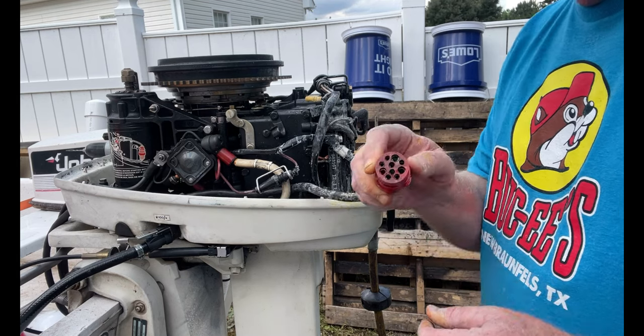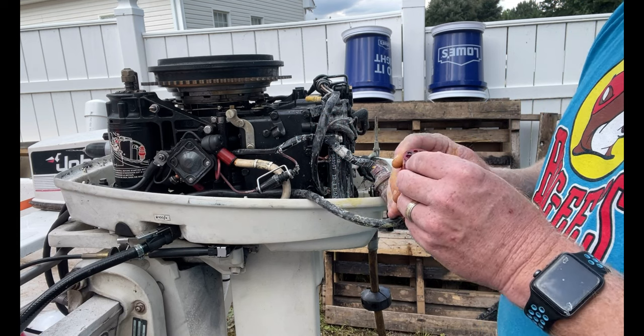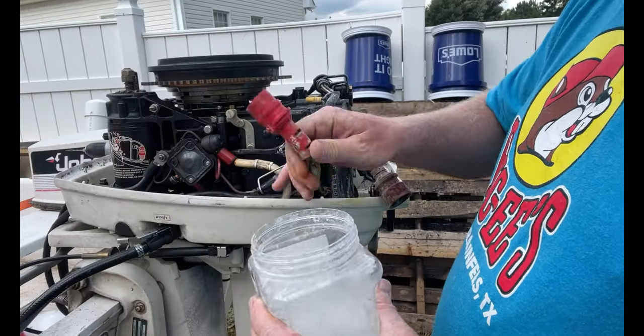What I'm going to do now is take a very small drill bit and put it in the chuck of the drill. Then I'll take some steel wool and wind it around this to make just a little bit of an abrasive. This looks a whole lot better now. I don't see very much of the green — I do see a little bit of yellow — so we'll go back to the baking soda solution.